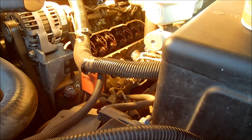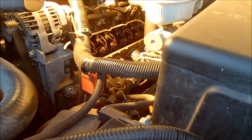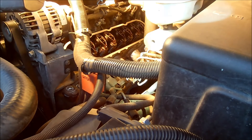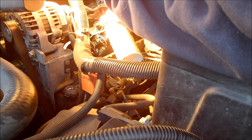This engine's got a lot of varnish on it. It's not too chunky. At first when I pulled this off it was like a horror show — I was horrified — but then I realized it's not really that thick. It is on the valve cover, but it's not on the rockers. Now that I spray this B12 down the rockers, the varnish is coming off.